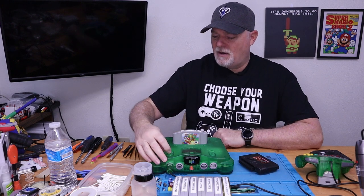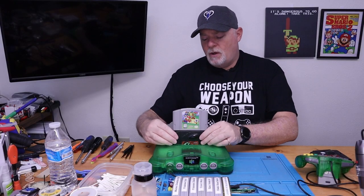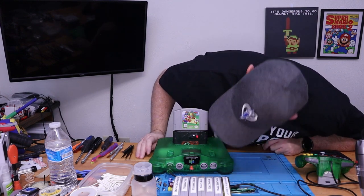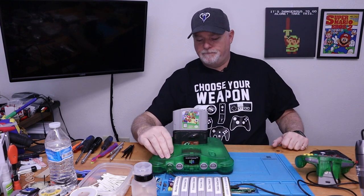Let's verify that our cartridge is working still — and it is. I've got the volume down because I don't want to get hit with any copyright issues. So our cartridge is working. Now I know this GameShark is not working. If we turn it on, we probably won't get anything — and as you can see, there's just kind of a random character, it almost looks like an A. Don't give up. Sometimes if these have been sitting, go ahead and reseat it, do it a couple times even. We get the same character. We got nothing, which is what I was expecting.